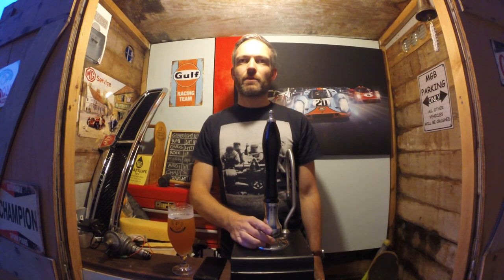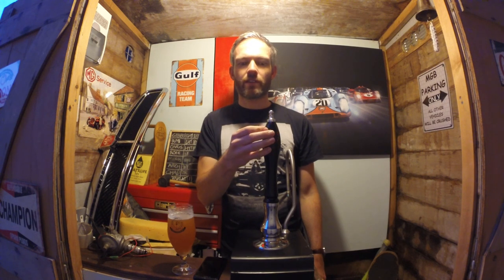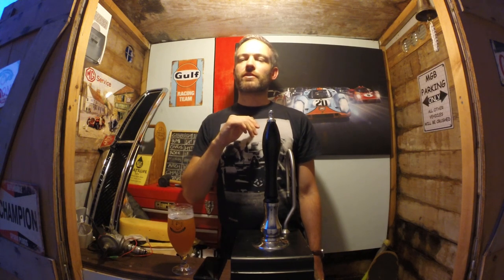The thing that differentiates cheap electronic ignition — this one is something like PowerSpark or AccuSpark, costing about 20 to 30 pounds — from more expensive systems is the ability to select your advance curve. As the engine goes up in the rev range, you want to advance your ignition by a certain amount so the spark happens at the right time. These cheaper systems have a fixed advance curve, so if you've got a modified engine you probably aren't getting the best out of it. More expensive systems offer a variety of advance curves for standard, different carbs, or stage two tuned engines.